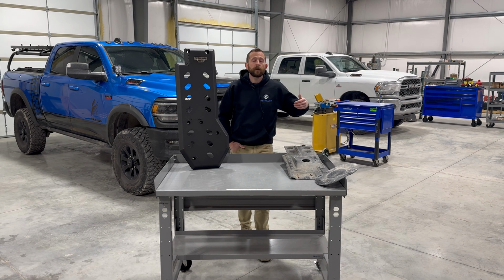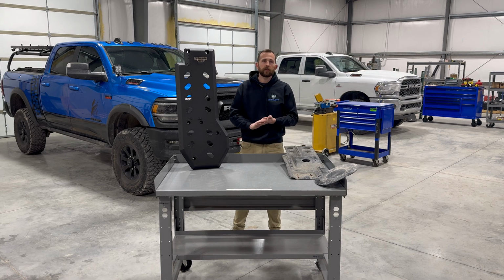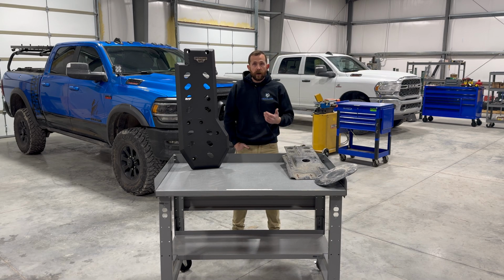and because it's at the center point of the truck, if you were to break over a berm, a snow berm, a whoop, a rock, a tree that's fallen in the trail, you have a very high propensity for landing the truck straight on that cross member. If you crush the DEF pump, you will cause an alarm in your emission system, and your truck will at some point go into a limp mode.